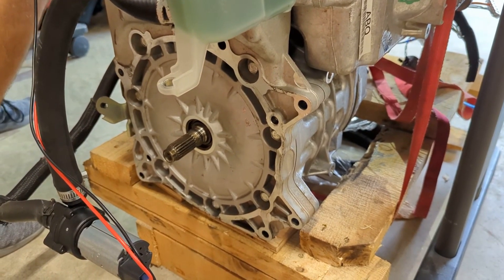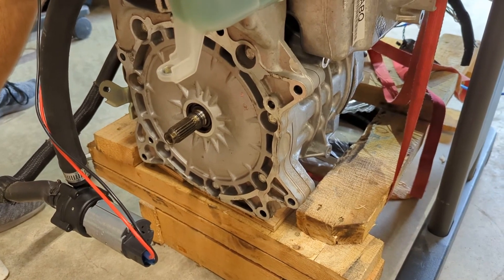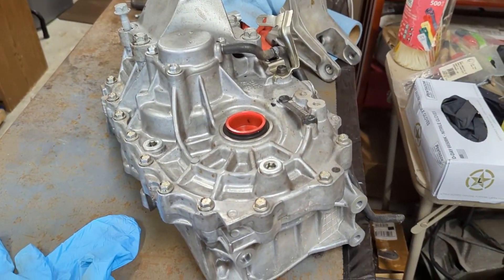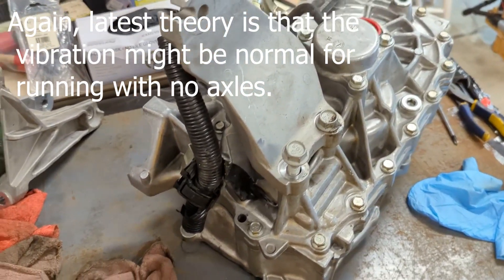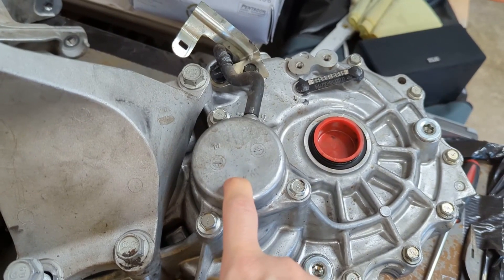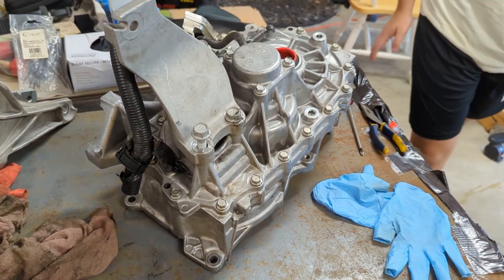That's pretty cool — that's the first time we've taken it up that high. I heard maybe some very slight vibration, but no, that's not the noise that we heard before. The other noise was more like a rattle. So that's definitely not the same noise. I'm pretty sure that means our problem is somewhere in the gearbox, which is good — I have a better chance of fixing this than fixing a motor. Next step will be to get this thing open. A few theories: the parking pawl that's disconnected in there may be vibrating at really high speed — we don't need it so we'll take it out. Another theory from the forums is that the grounding brush may be loose or disconnected. We'll drain all the fluid, open it up, and just see what we see. If nothing else, we're going to learn about it.